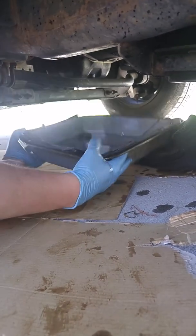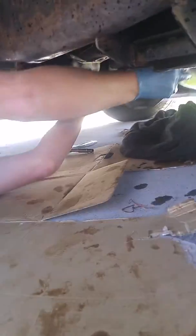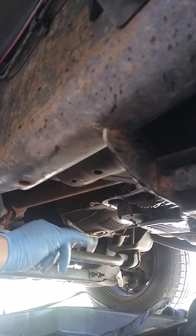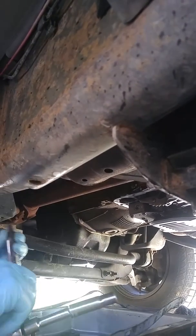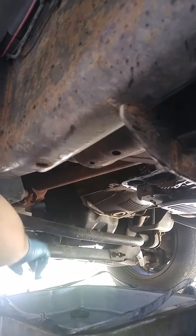When Ford does it, you can use the reusable gasket, or you can just put a new one on. Once you get the filter in and the gasket held in place with the bolts, go ahead and bolt it back on. It's not going to be torqued very much — more like hand-tightened with your ratchet.